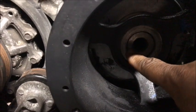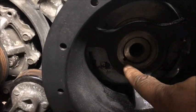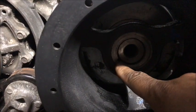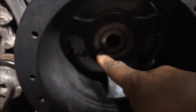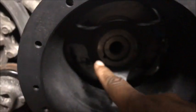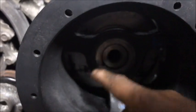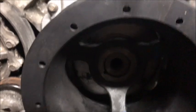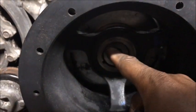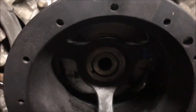Let me show you what I'm talking about. There's the keyway opening right there — for an LSA keyway. I'm going to line one of these holes up right with this. Being that the drill bit is bigger than this hole, it's going to drill right into it and that's going to be my first hole. And then of course I'll make the second one over here. That's where I'll pin it out two ways. Whereas if I put one here, one here, then you got three holes, and I don't want to do that.